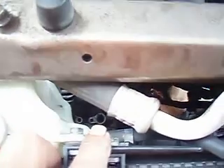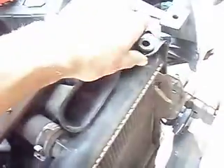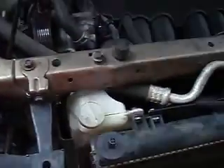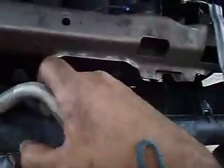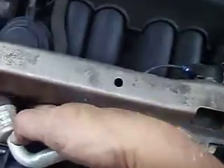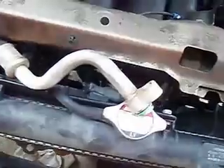you can see it where it goes right down there — you're gonna have to loosen up your radiator mounts so you can tilt it forward here. We had it out so that you can stick your hand down inside there to get your return hoses off from your compressor.